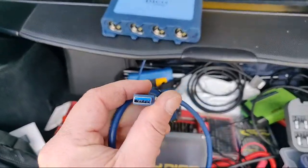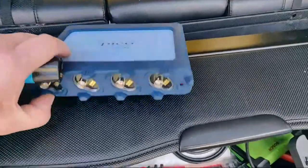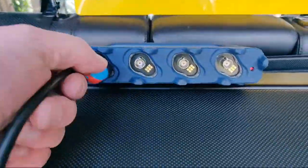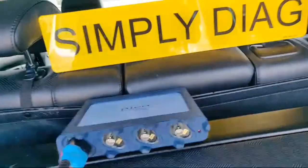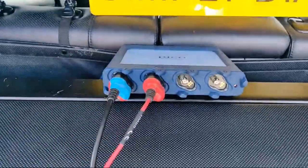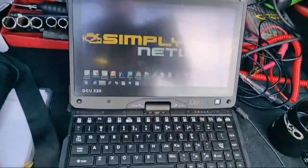At the business end you can see the four BNC plus connectors, and there's a light on there to show it's ready - so it's powered up with the high-speed USB 3 connector. If we plug the clamp in - this is the business end of the current clamp, you can see it's red and blue. Then we've got our battery cable - it's a simple push fit, no more turn and twist, so hopefully no more worn out BNC connectors.